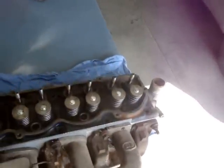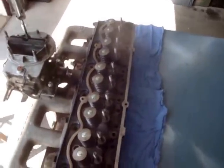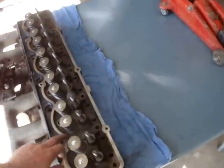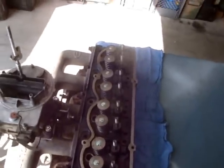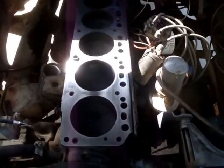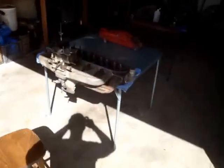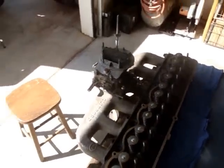So that's about it. I'm excited to get this in — I think it'll be a pretty big improvement over stock. These heads really weren't built very well as far as airflow, so I think porting them really helps. It doesn't seem to do much good to put a big carburetor, intake, and exhaust on without porting the heads. My mechanic said I did a pretty good job for my first port job, and you can get a lot more airflow in and out for more power. The bottom end of this engine is in pretty good shape — the engine is actually out of a 65, original as far as I can tell — good compression, good oil pressure, so I'm just going to leave it. Hopefully if everything goes good I'll have it in and maybe even running this evening. Then wood cutting season — we'll see how it does hauling some firewood.